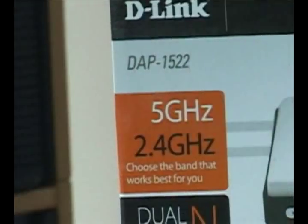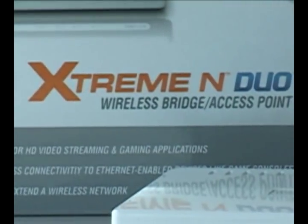The access point mode would be for when you have an older router that's 802.11g and you want to upgrade, but you have all your settings already in your 802.11g router. You can shut off the 802.11g wireless built into the router, connect this into one of the ports, and then you have an 802.11n wireless network. Or maybe out in your living room you have a game console that either is 802.11g or doesn't have any wireless built into it — you could shut off the 802.11g in the device, plug it in here, and use it as a bridge to connect to an 802.11n wireless network.